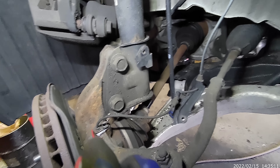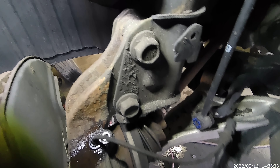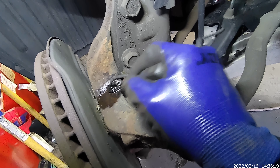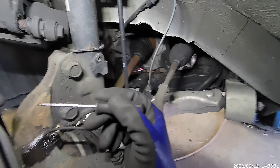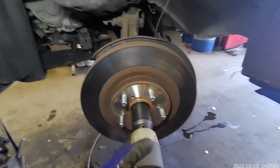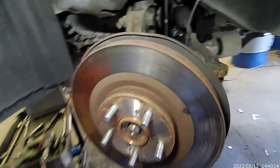What I'm doing is wiggling it. If you can, clean it around so the WD-40 can penetrate faster. I'm using a light pick — a pointy light pick, or whatever you want to call it. 35 socket. Now it's loose, so I don't have to worry about it.